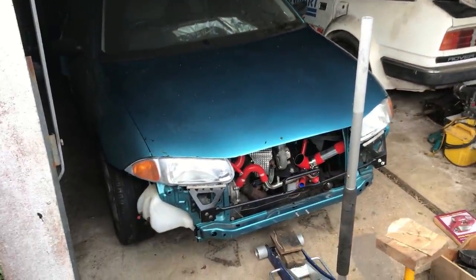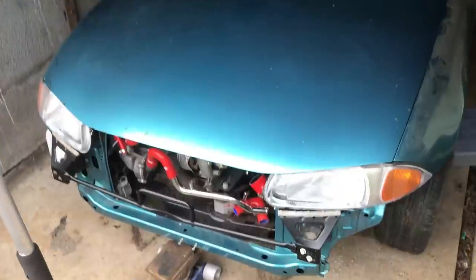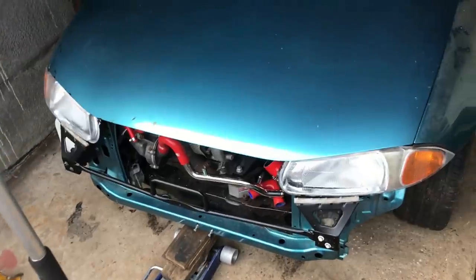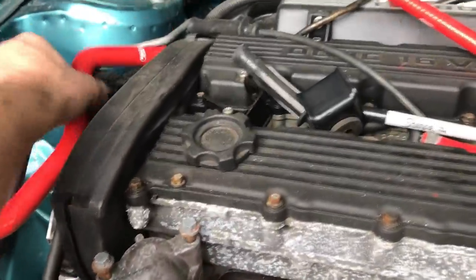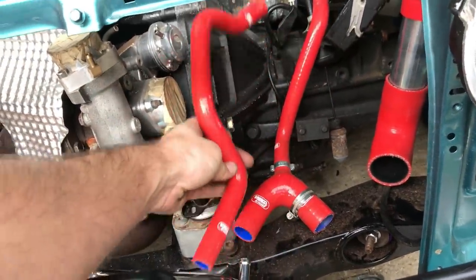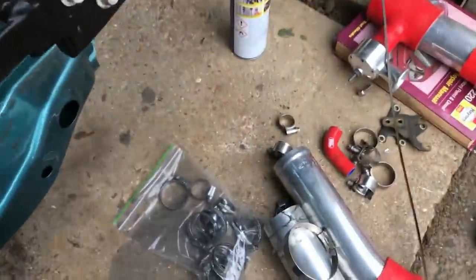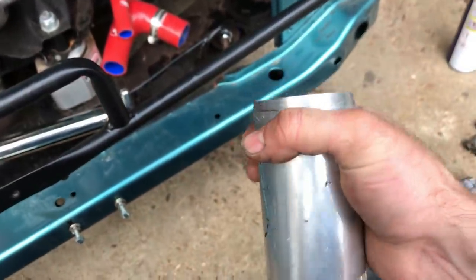The next logical thing is to reconnect all of the coolant pipes, put the rad and the intercooler back in. I'm quite tired - my thought processes have slowed right down. Getting this wonderful feeling of deja vu trying to remind myself where all of these various pipes go. Basically this should all be fine to go back together. For the intercooler pipes I made myself a beading tool, because at boost if you just have normal clamps these will just pop off.